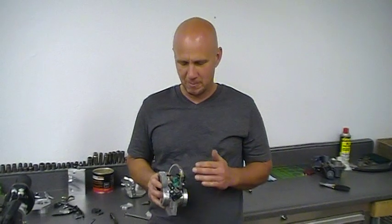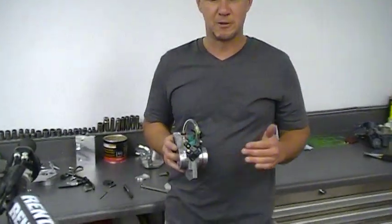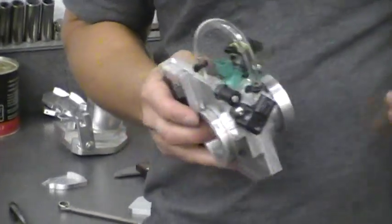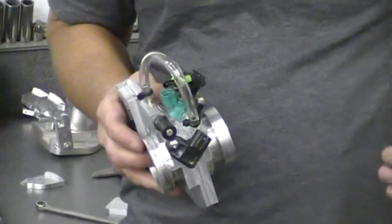I've taken the last three months off and just concentrated on this thing. The injector being on top at a really good angle, close to the valve — instant fuel all the time. The air-fuel ratio is 12.5 to 13.1 all the way through the range when you run it with the stock programming. So it's just bolt on and go.